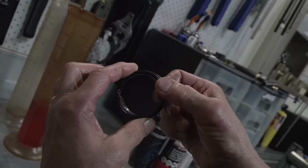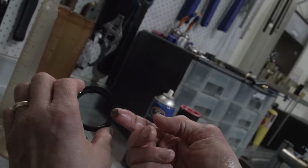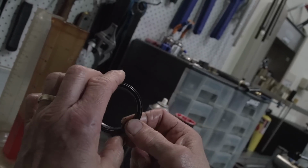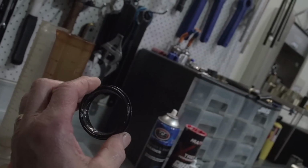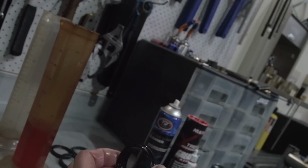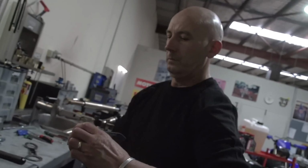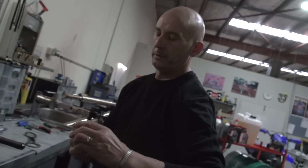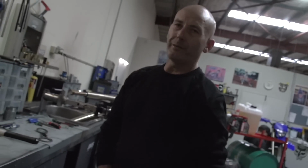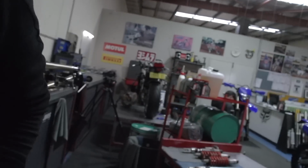That's right. See that? So that's just been, the dirt gets in there and gets trapped in there. It just holds that lip open, doesn't it? Yeah. Until it builds up and then hits the oil seal. And that's basically some mud drying at the bottom of the fork leg, and then you have a big case out and just punch the seal straight over the top of that crusty dirt. I mean, I know you can get those seal savers, but it doesn't get everything out. And they hang on to it as well. Same thing. They keep it at the seal's edge.